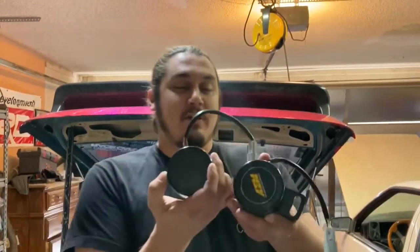Also on the cards is, I know these two pieces will pretty much look the same. From the camera here, these will probably look the same, but one is actually mounted to a distributor adapter, and the other one is not. This is the older timing puck that we tuned the car and everything on. I had suspicions that maybe that had an issue going on, so I got a new one, but it only made problems a little bit worse. So we're gonna go ahead and put the old one back on, put that back in the car, as well as the exhaust, and should be able to get us a little bit closer to figuring out what's going on with the car.